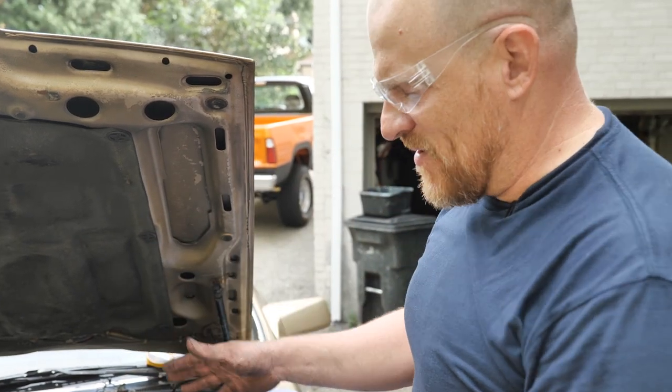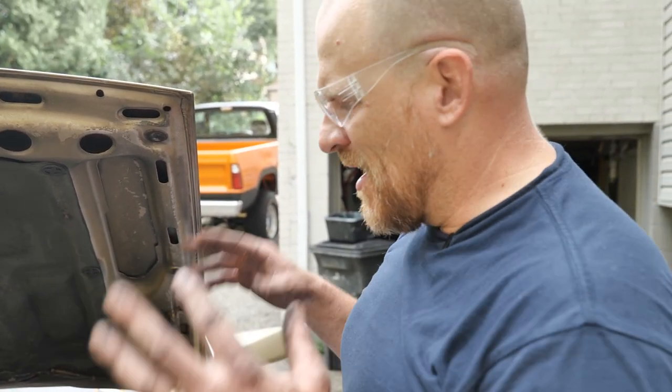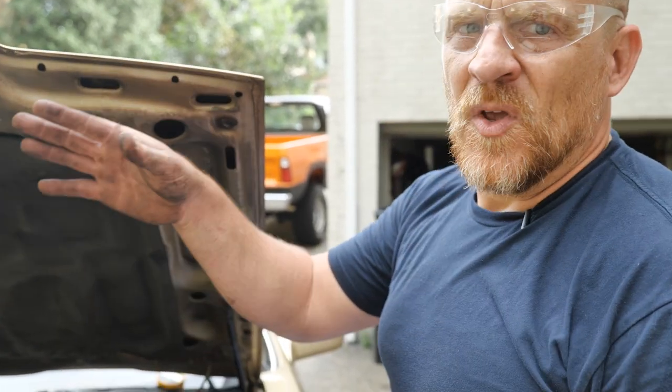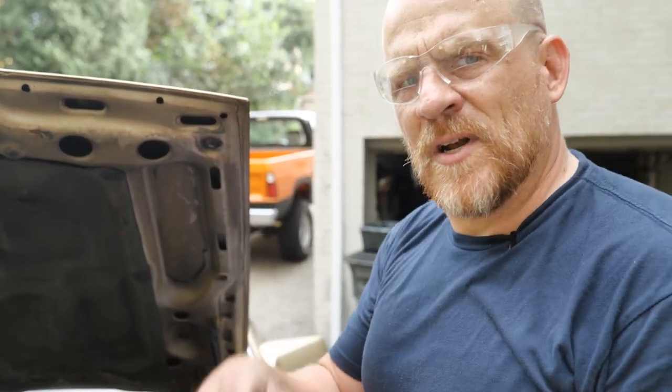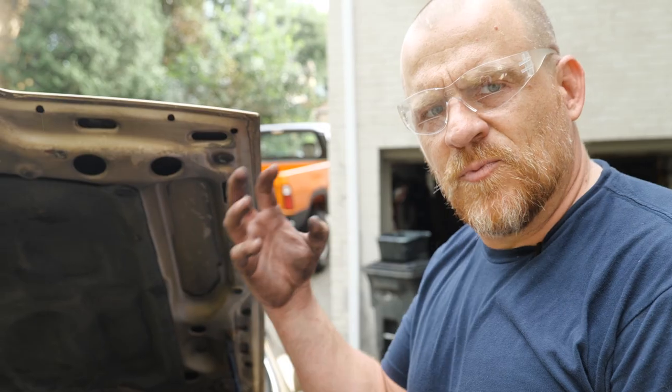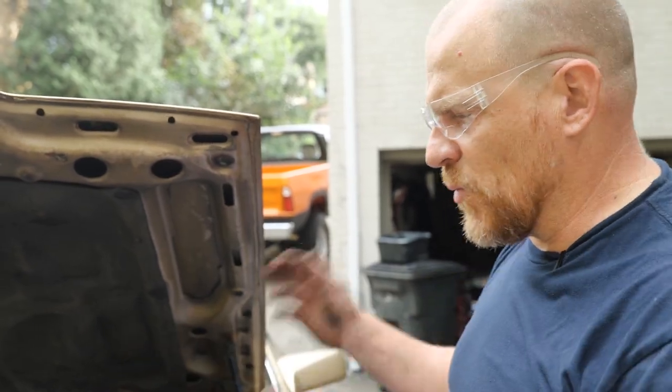Most ridiculous air intake ever, once again. But I'm going to finish that part. I'm good with the pressure test. While Caleb's running out to the store, I'm going to pull this under a vacuum for the next 45 minutes. We'll get a final micron gauge reading after we do that, and then we'll recharge it.